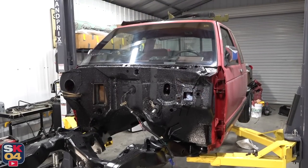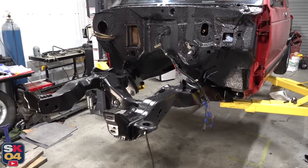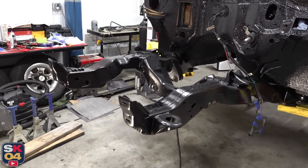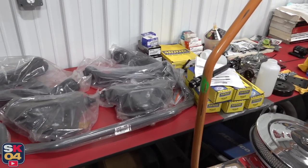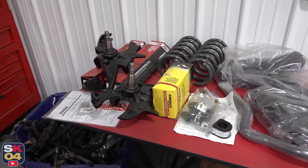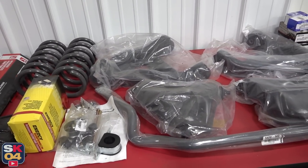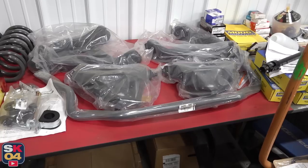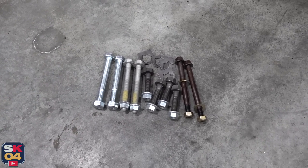The firewall and underside of the cab has been layered with sound deadener, and I also painted the firewall to give it a nice finished look — I'll cover all of that in the next video. The body's back on the frame with brand new bushings and hardware, and I can finally turn my attention to rebuilding the front suspension. Quick recap: in addition to rebuilding the whole suspension from scratch, I'm also lowering the truck about three inches in front and four to four-and-a-half inches in the rear. Since this is an extended cab with a two-piece drive shaft, I'll also install a pinion alignment kit to make sure everything stays aligned. On top of all of that, I'm also installing sway bars. And of course, this wouldn't be a restoration without all new hardware — the entire front suspension is going to be brand new down to the nuts and bolts.